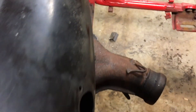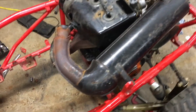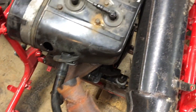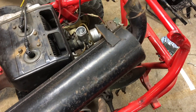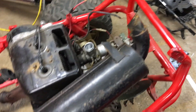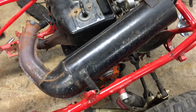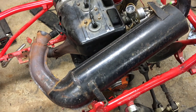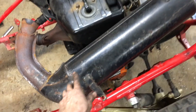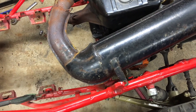This is the exhaust that's going to be hitting me in the back with the head. The exhaust will have to be routed a lot tighter to the engine to fit the seat — it's going to go up over the pulley and be routed out the back. This exhaust has two layers with some kind of preheating system for the head. I'll be able to cut off the outer layer, and it'll be a little bit narrower but will fit in there pretty good once I get it welded up.